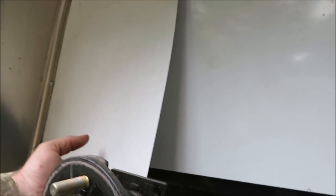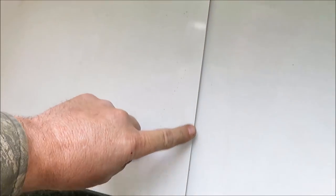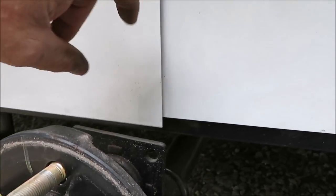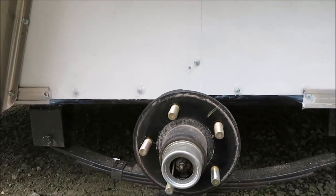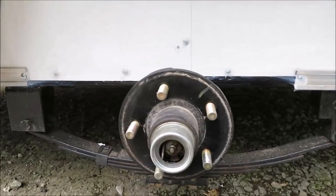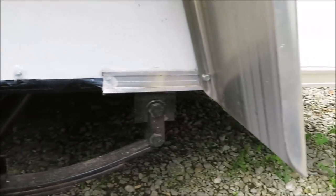Want to see something cool? This one's exactly the same way - it's not even screwed back. Not one screw from here all the way down, not one screw anywhere. This is how it came. So we're going to get her sealed up and screwed back. Both sides are sealed up now. I don't think we'll have any problem with them, but we'll keep looking this thing over. I haven't yet actually got up underneath it and done every seam, but I will go under this box trailer and do absolutely every seam on it.